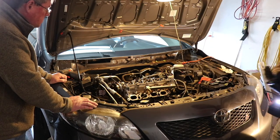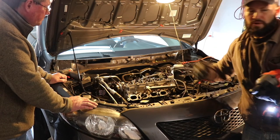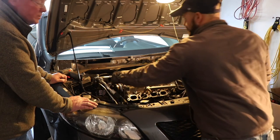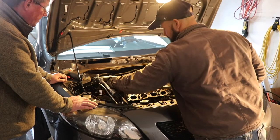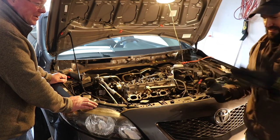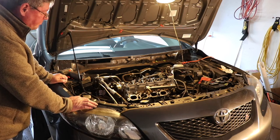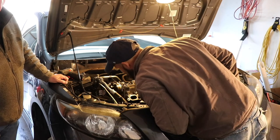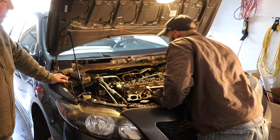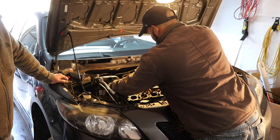And so now we're loosening up all of these retaining brackets that hold the camshafts on, and we're about to remove the camshafts. And it's very important that you remember which one goes where, the front and the back cam. One chain. Not two chains. So, also, the water pump is attached to that cover. And you gotta disconnect all the ports, all the lines, the water lines, in and out to that water pump. And it's down by the alternator, it's a real booger. So you gotta pull the intake off to get to those water lines behind the intake.